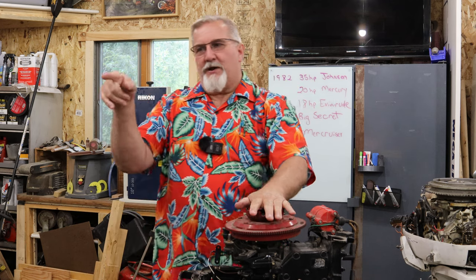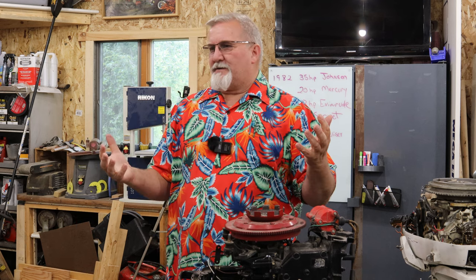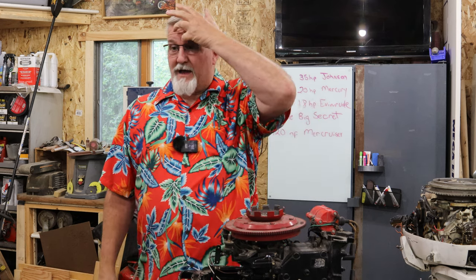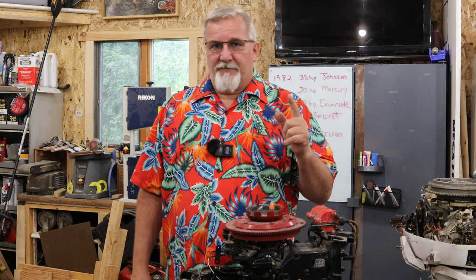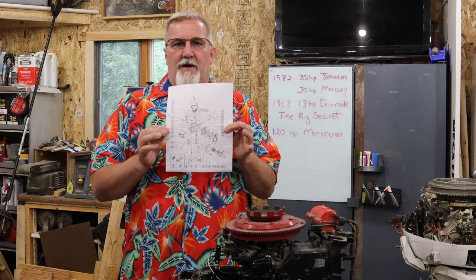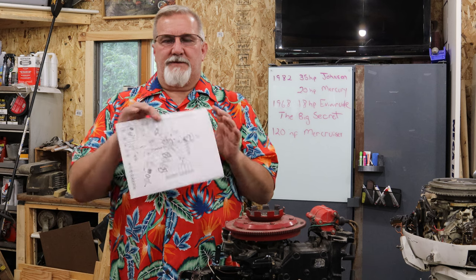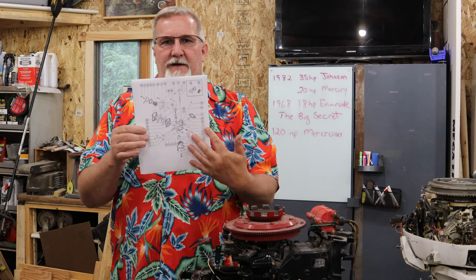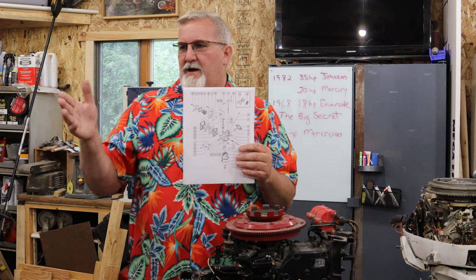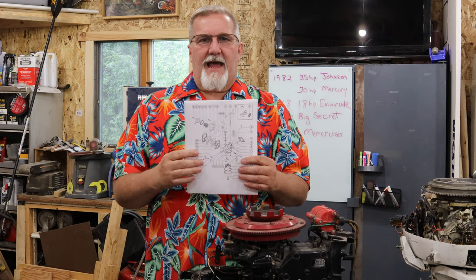Some of it's no secret but let's call it some cheats - do we cheat a little bit on doing carburetor? I'm not sponsored by marineengine.com or oldmercs.com but I do buy parts from them fairly regularly. If you go to marineengine.com they've got schematics for just about everything. I've actually printed off an exploded view of the carburetor showing all the parts and pieces, especially when you have a fuel pump built on the carburetor like this one - it shows the stack-up of the gaskets.